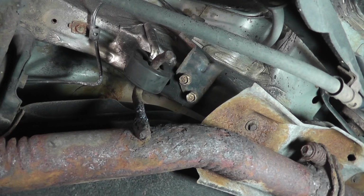This hanger is near the fuel tank. If you have any visible fuel leaks or smell even a hint of fuel, don't cut anything under the vehicle until the leak is repaired. Normally, if I had to cut an exhaust hanger off, I'd use my angle die grinder, but I'll use a Dremel tool here. While it's not the most efficient tool, as you'll see, it's a tool you'd be more likely to have.